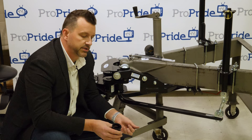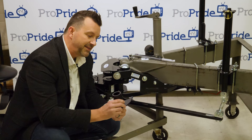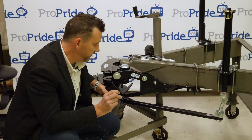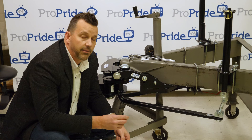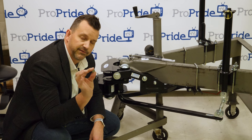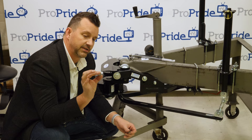For the weight distribution spring bars: the bushings come pre-installed in the main unit, held by one bolt on each side. If you're wondering where they are, they're in the bottom of the main unit. Also included are two retainer discs that hold your spring bars into the bushings. If you lose them, you can substitute a 3/8-inch hex nut — it works the same way.